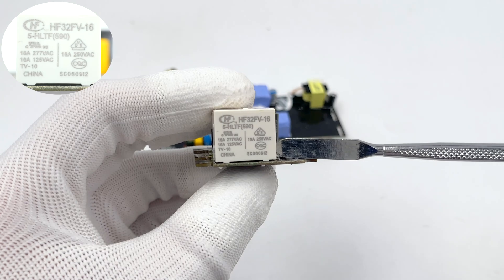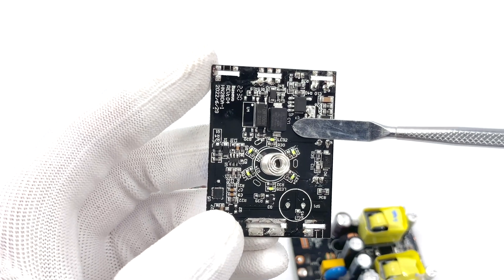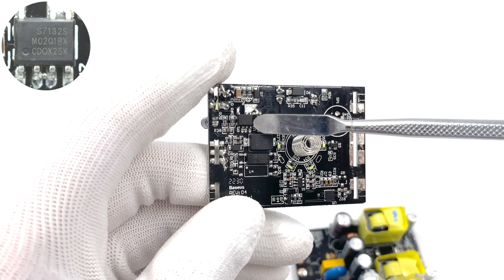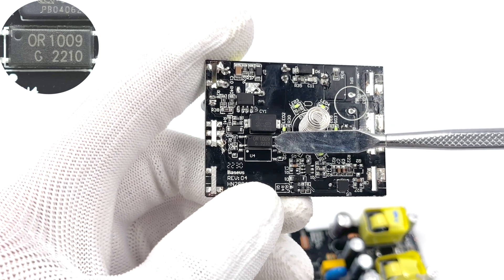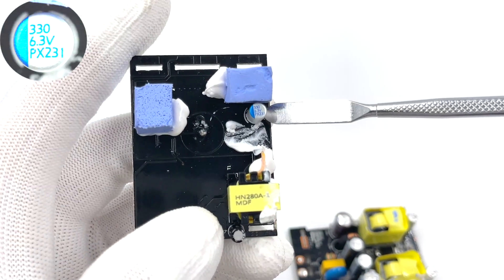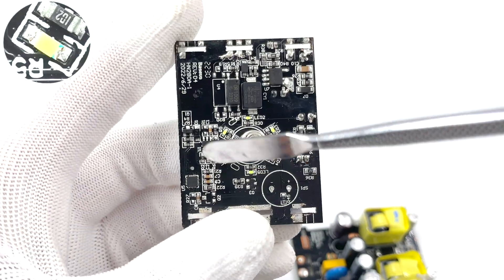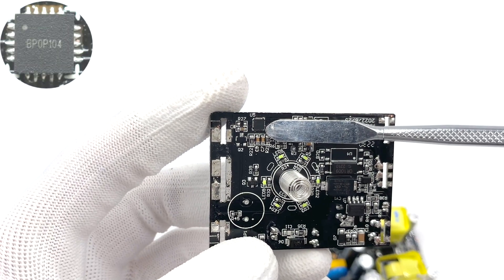This is another small control PCB used to detect overvoltage, overcurrent, and control the power button. It integrates LED indicator lights, switching power supply, and MCU. The buck chip comes from BrightPower Semiconductor and adopts SOP7 package — a switching power supply chip controlled by the primary side. An optocoupler is used for charging status feedback. The SMD Y capacitor is from TRX. The Schottky diode is used for output rectification. The solid capacitor for output filtering is from CapExon, 330μF, 6.3V. A circle of LED indicators around the spring can indicate the working status, and the MCU handles overvoltage and overcurrent protection.